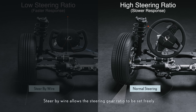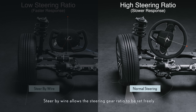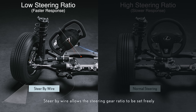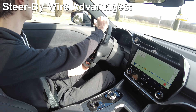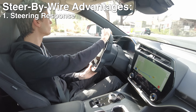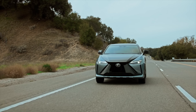Steering response is ultimately limited by the steering ratio. A high steering ratio means you have to turn the wheel a lot in order to get the car to turn. A low steering ratio means you turn the steering wheel less, corresponding to the front wheels turning a lot. So the shorter your steering ratio, the more responsive your steering is, because it takes less hand movement to rotate the front wheels. It's a simple fact that less hand movement is faster, so the response of short ratio steering systems is quicker. Well, there are two big problems here. First, if you use a short steering ratio, steering is difficult and requires a lot of effort, but this can be overcome with steering assist systems.